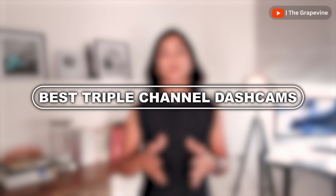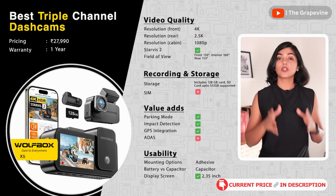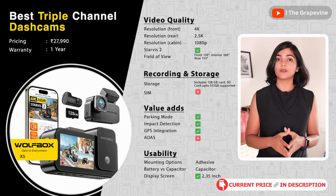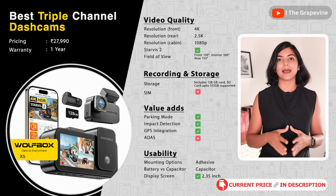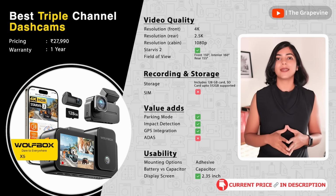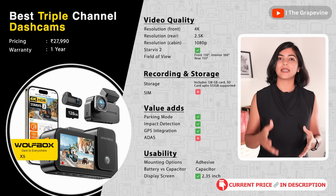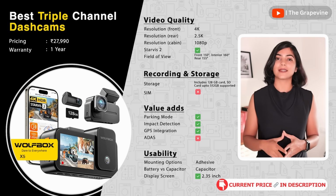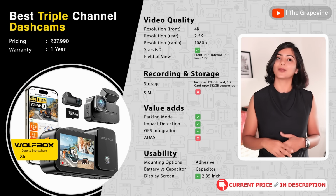Next, let's discuss triple channel dashcams, which are ideal if you want to record within the cabin as well. My first recommendation is the Wolfbox X5 dashcam. With a 4K resolution with Starvis 2 front camera, 2.5K resolution rear camera and 1080 cabin camera, this provides full coverage during your drive. A 128GB card is included in the purchase, and this uses capacitor for saving the video if the power supply to the dashcam is suddenly cut off. This does include GPS logging but does not include ADAS.